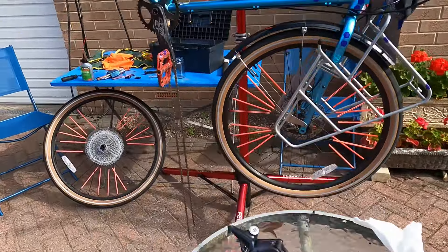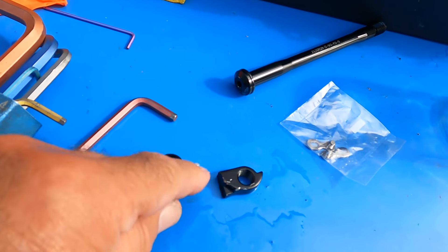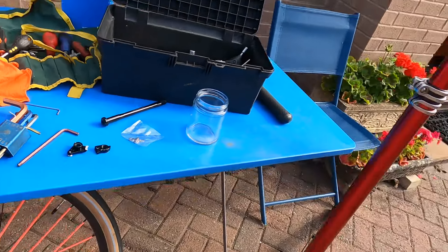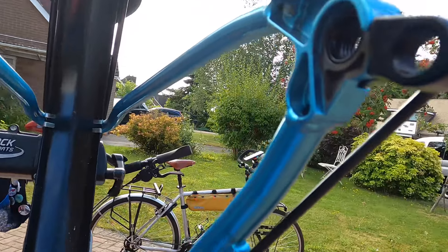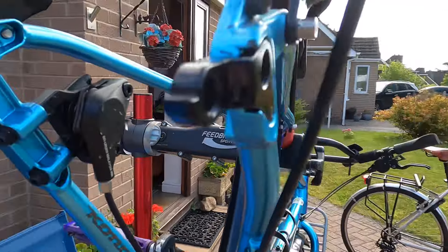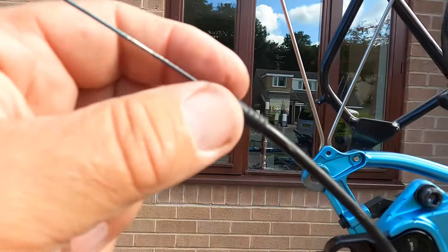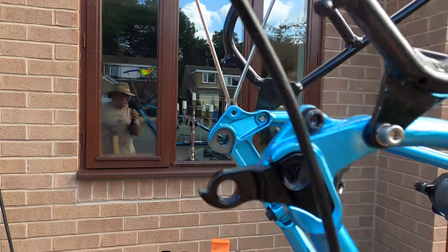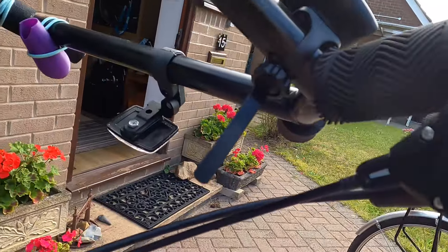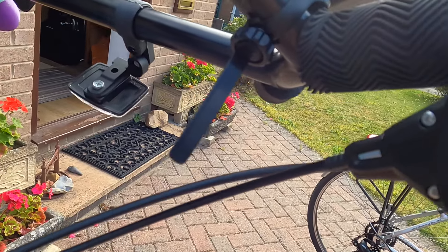Let me show you the preliminary work. You've seen the gear hanger on the previous video — it was broken. The new gear hanger is now in place; it's a threaded through axle that will need to be torqued to 11 Newton metres before the bike goes back on the road. I've also replaced the plastic ferrule where the cable hooked behind the rack, and I've been dropping lube down the cable all morning so it's been soaking through. I've also pulled back the cable on the gear shift and dropped lube down there, so the cable is going to be nicely lubed.